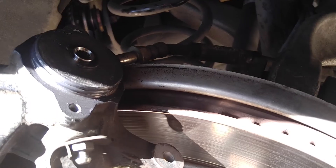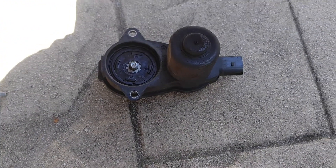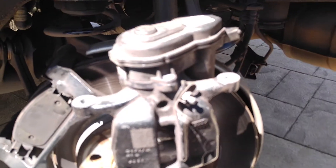I did place a little O-ring grease from Brimble around it. Now I'm just gonna reinstall my actuator. The actuator can only go on one way, but the plug needs to be facing to the rear of the car.